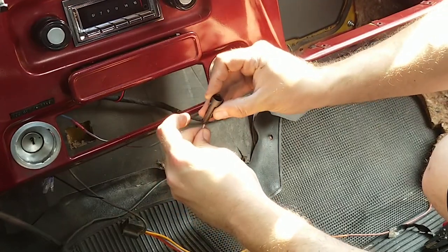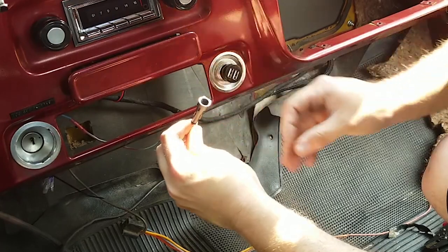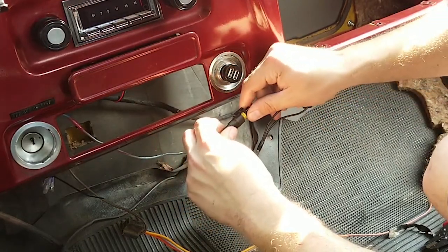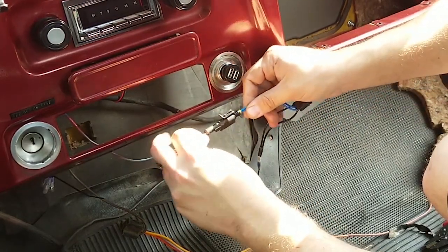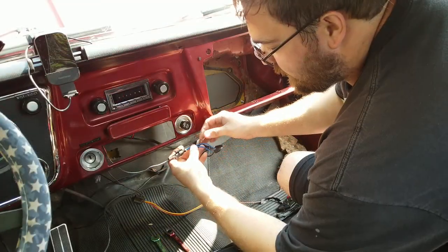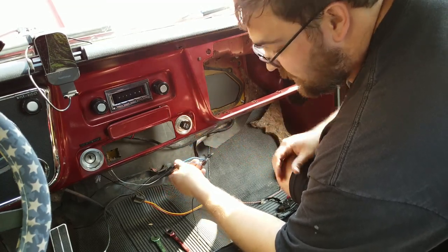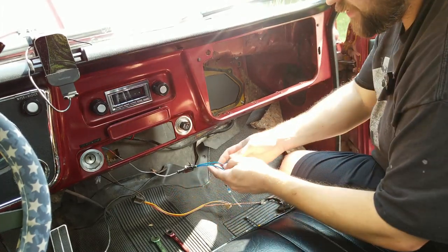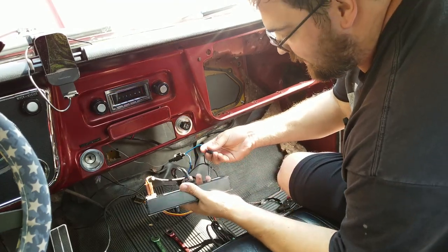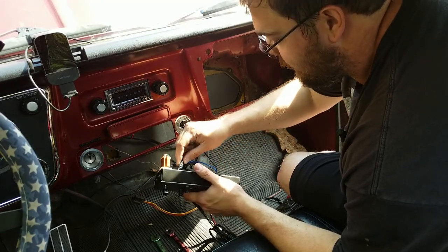And then this wire, just like the other, goes in the connector, like so. And this plugs into here. Like so. And there you go. Now we have connections to there for the lamps. And we're able to unhook this anytime to service without having to take the bulbs back out of the unit. Not that that's that important, but I don't like making hardwire connections in the truck. It's way easier to use crimp style connectors when you're already in the truck, in my opinion.